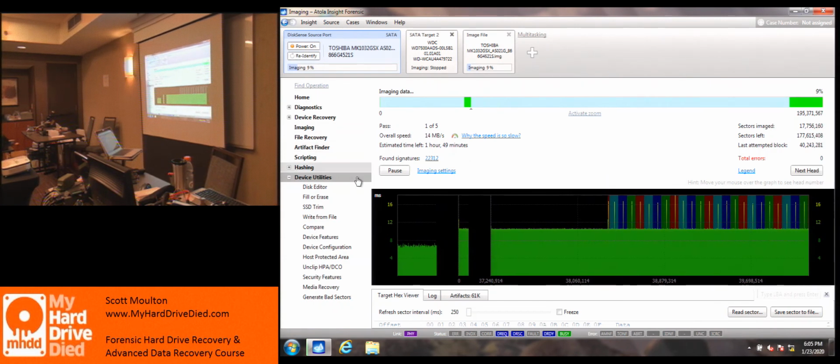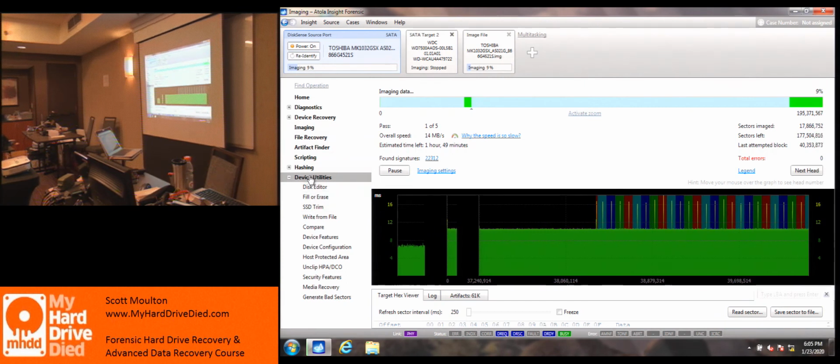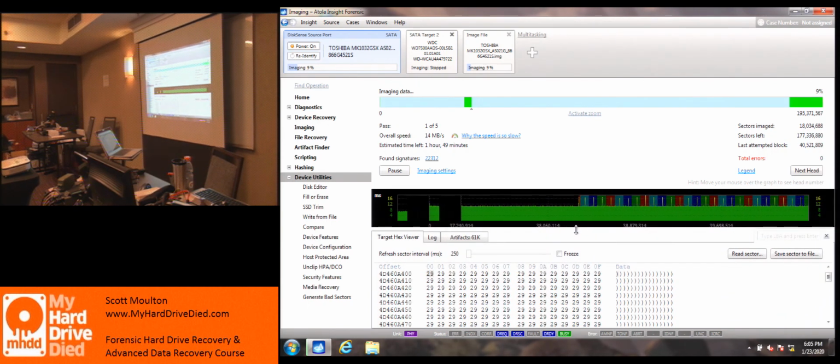So, all right. Anyway, that's the whole rundown that I've got. There's a lot of little things, but as a whole, that's generally the entire process that we run. I have three running at least all the time in my office, and every single thing that we're done with something else, we'll throw it on this, or we'll clone something, or we'll make a DD image with it, and do basically the same thing that we're doing with the Falcon, except this can obviously deal with damaged sectors and the Falcon can't. It'll crash. It won't deal with it at all.